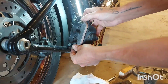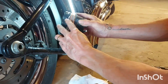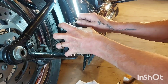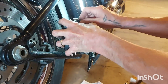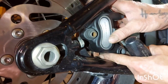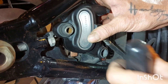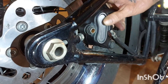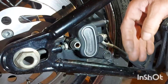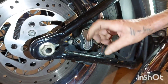There's one pad in — slide the pin through, get that one up, and the second one. Start tightening them up just by hand for now. Once you've got the caliper slid on, there are two little end tabs on the brake pads and they go into this retainer right here. Let's go ahead and do that. Watch that one too — there you go. You'll see the pad on the inside; you have to line them both up and they have to fall into that slot. The bolts will not line up unless those tabs are in place.